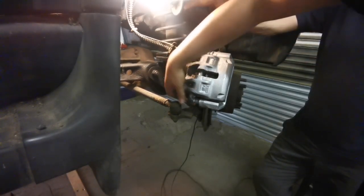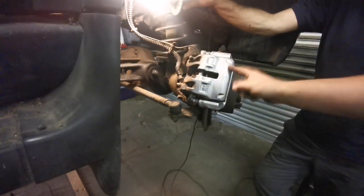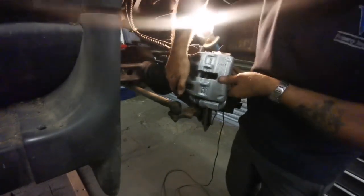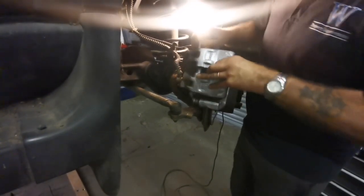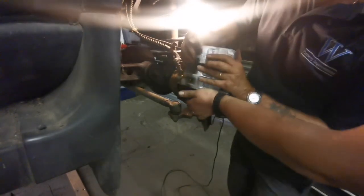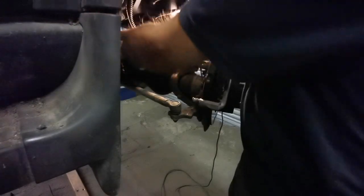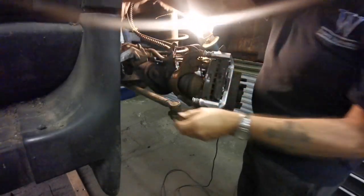Those are nice and easy to get off. This is the first one that's come off — pull that off then. You can just rest that on the steering bar there, any way you want. Just when you put it back on, make sure you don't twist the pipe, because that can also be an advisory on the MOT. And the pads can come out.